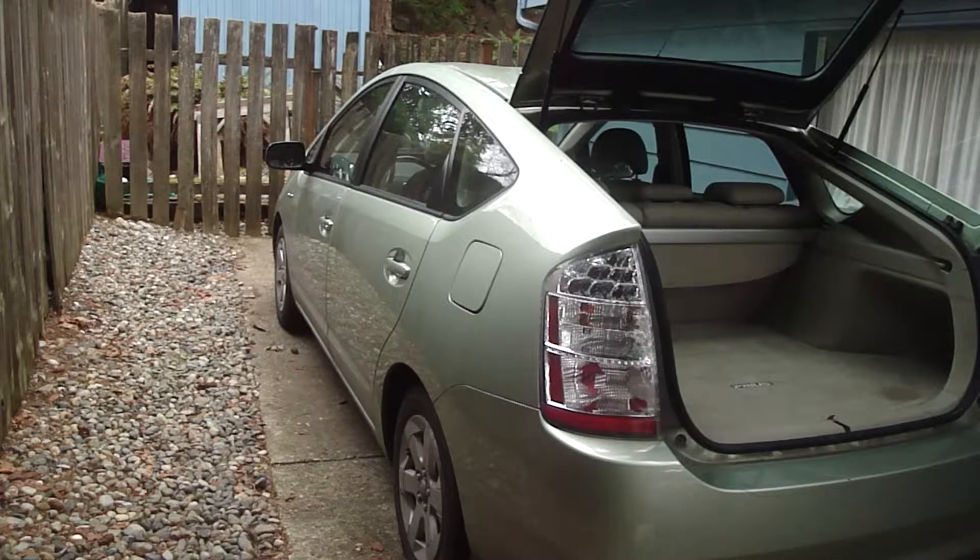I'm not a great diagnostician, and I'm also not great with electrics either. I saw that ChrisFix video about how to replace the whole battery, but there are other ways of repairing a battery where you can just take it apart and test each cell separately and replace the bad cells. Then you rebalance the battery by putting the cells in different locations — the older ones go to the outside and the newer ones go to the inside, because there's more heat experienced where the cells are on the inside of the battery.